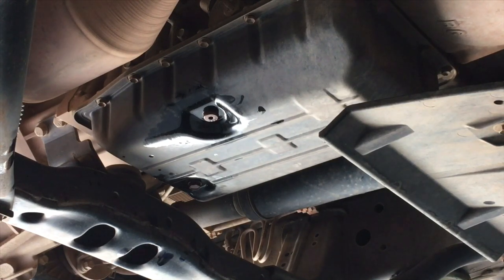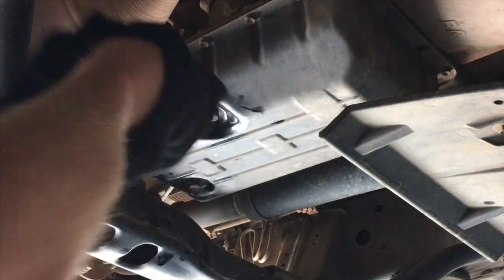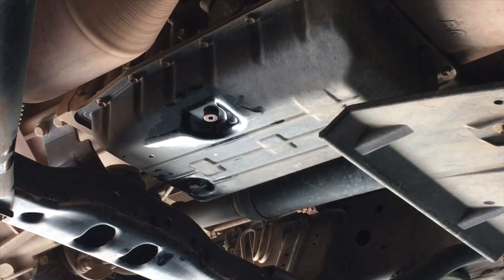Just a little bit of info at the tail end. If you've got something out of that, give us a thumbs up and subscribe — we've got heaps more awesome information coming your way. We've been using the Penrite FS, which was available for these before the LV. The LV stands for low viscosity. We spoke to the Penrite experts and they said the FS was fine — the only difference is the viscosity and it's absolutely tiny. The FS is more available and it's cheaper. I suggest you get a 20-litre drum even if you're going to bring it to us. It's your transmission — a very expensive component and you need to make sure it's done right.